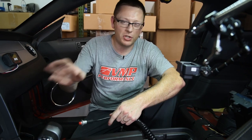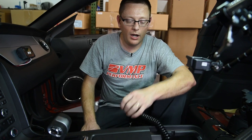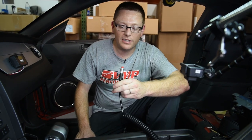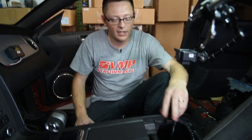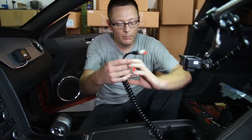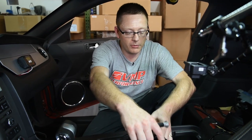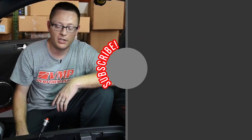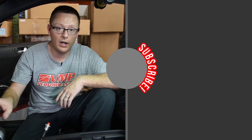We're all finished up here. There are multiple ways that you can run the switch. Motion Race Works makes a button that mounts on the steering wheel, or you can mount a button up on the dash. What we chose to do is a cord with a handheld button. The reason is that with driving it on the street, you can tuck this thing away in the center console, close the lid, and you don't have to worry about accidentally hitting it while driving. When you get to the track, you can open this, pull it out, run it through this little channel, close it, and you have your trans brake. You just hold on to it on the starting line and let go to launch.